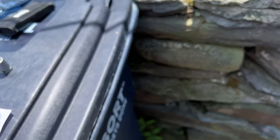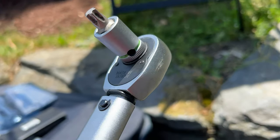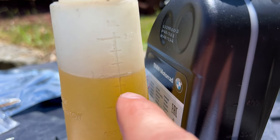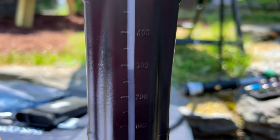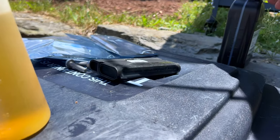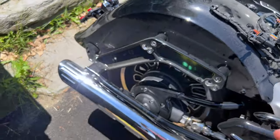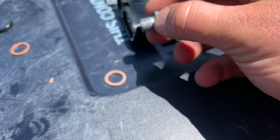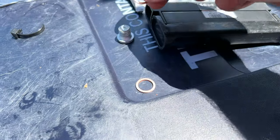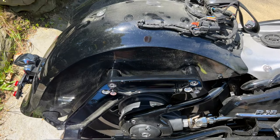Don't forget to torque to 20 Newton meters on that bottom drain plug before you refill. Grab your syringe and put in 210 milliliters of the G3 axle oil. There's about 300 milliliters left in the bottle, so there's enough for two final drive fluid changes. You can use non-BMW branded oil as long as it meets specifications, but it's cheap insurance. Replace the crush washer and torque the top fill plug to 25 Newton meters.